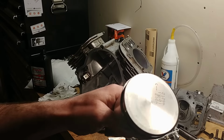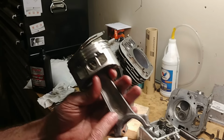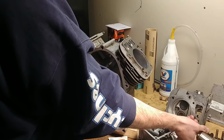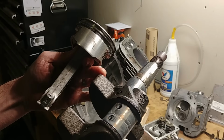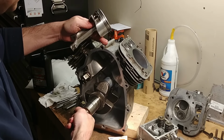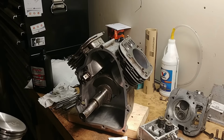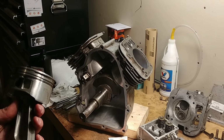We got, see if you can see the arrow pointing that way. And we got our number 1 over here. So this is cylinder 1. So what you want to do, sorry, I forgot this. Crankshaft, pre-lubed. My journal is all nice. I did the bearing in the block. So we slide this through. Make sure you lube and replace your upper PTO seal. The upper one doesn't leak because all the oil's on the bottom, but it just makes good sense to replace it now.